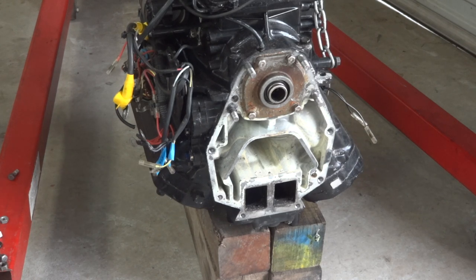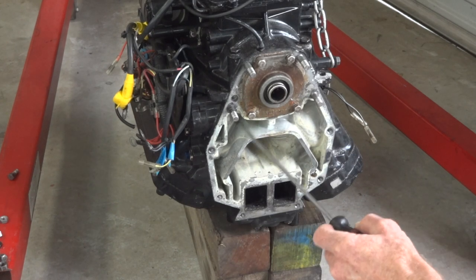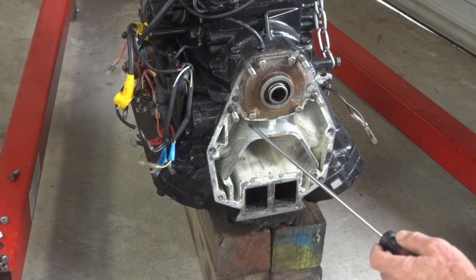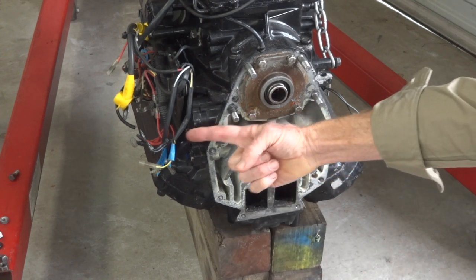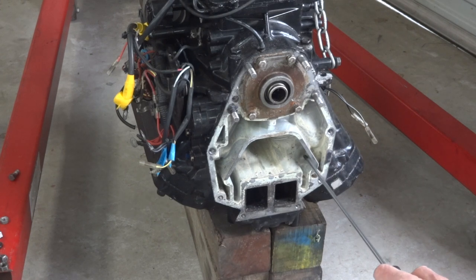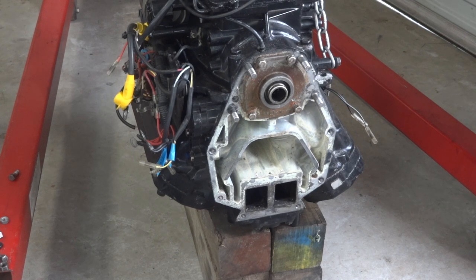Moving along now to the back of the engine, where our sandwich plate goes — these are the two water cavities. I'm going to put water in here and take water out there. We've got a plate and a gearbox over the back of it, which makes it a bit challenging. But fortunately there's a poppet valve up in here that lets water out of this chamber into this little thing and down the leg, and we can take that off and get water straight out of the side there. Actually, that's where it goes in. Getting it out of here is more of a challenge because it's completely covered by the gearbox. But luckily the Mercury guys put a little extra bit down here to keep the exhaust cool, and I think we can just sneak some out of there and out the side — we'll see in a minute.